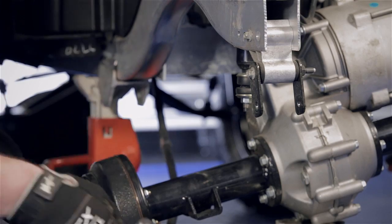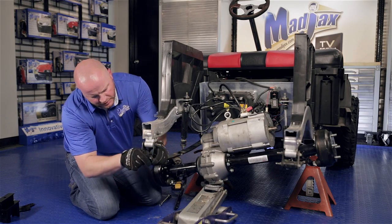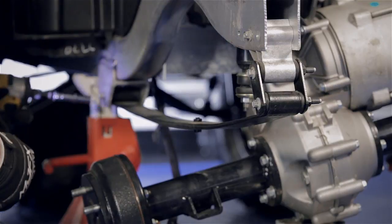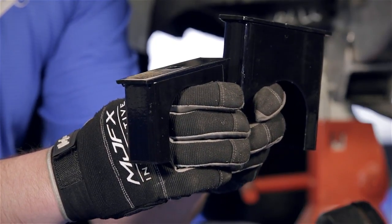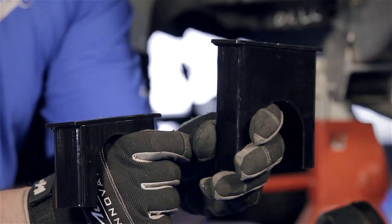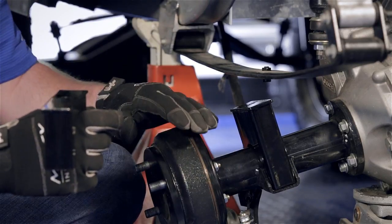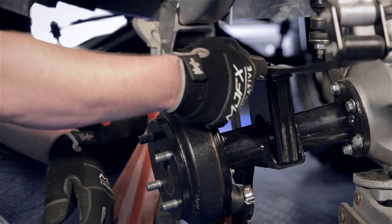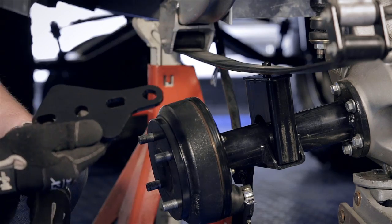Now we're going to lower the rear end, insert our spring on top of the axle, and reattach. We're going to leave our brake cable unattached until the very end. You will notice two different sized sets of rear lift blocks — the short blocks are for carts where you're putting HD springs on the rear, and the taller blocks are for OEM springs. The angle of the top of the block goes towards the front of the cart. Take the rear lift block, sit it on top of the rear axle, and use your floor jack to bring it up to the bottom side of your rear leaf spring. Make sure the leaf spring nut on the bottom side lines up with the hole in the top of the rear lift block. Now we're going to take the rear shock plate and install it on top of the spring and attach our shock using our factory hardware.